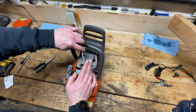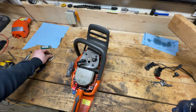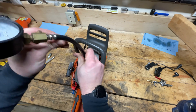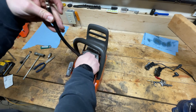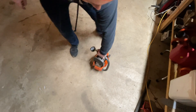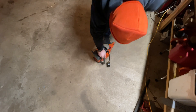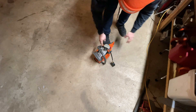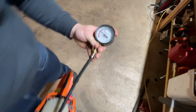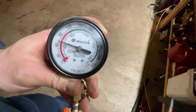Let's pull the spark plug out and do a compression test — it only takes a few seconds. The plug's got some fuel on it, which means we're getting fuel into the cylinder. But when I was pulling it over, it just didn't seem all that tight — not the compression I normally like to see. Ten pulls with the decompression valve out. Just as I suspected — 60 to 70 PSI. Not enough to run. That's going to be the issue.